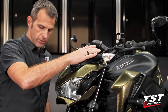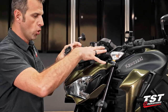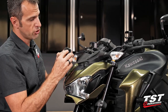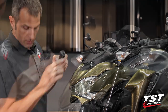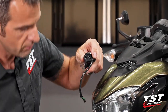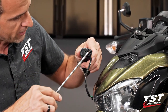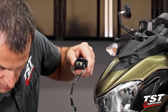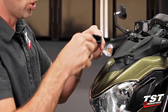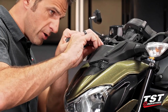Now that we have access under here, I'll show you how to remove these signals from their captive geometry. I don't really want to remove all of these plastics — this installation can be done without that convoluted an approach. We can access these screws on the signals at an angle. Once you remove this screw, the retaining bracket comes off just like that. There's another jamming bracket inside. This bracket is responsible for jamming the rubber boot open so that you can't pull it out of its retaining geometry. Now that it's gone, you can grasp it, twist it, and take it off.